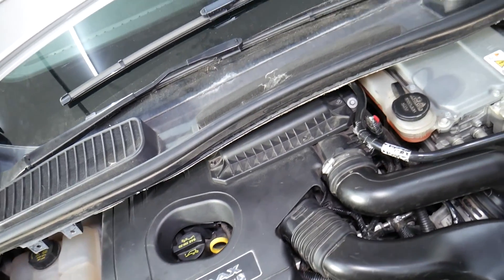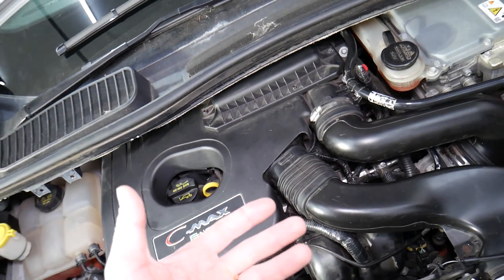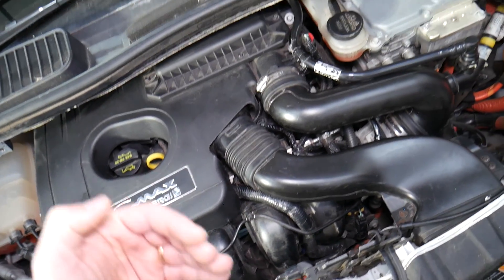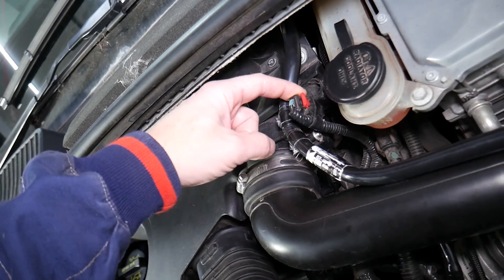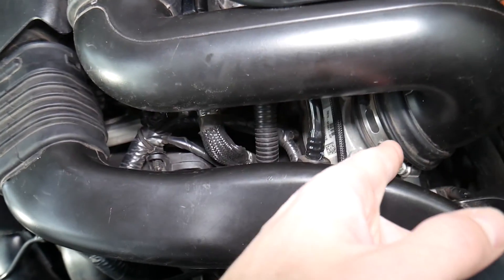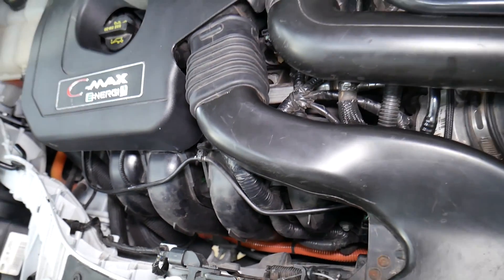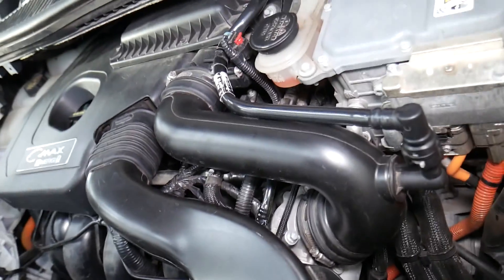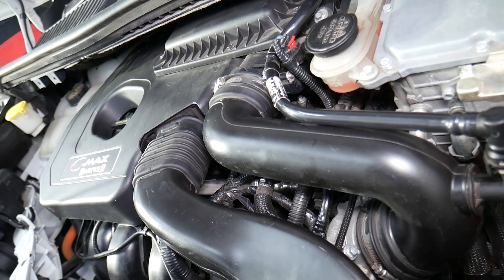The car can also have a misfire due to bad spark plugs or ignition coils. Common causes include a bad fuel injector, weak fuel pump, bad spark plugs, and bad ignition coils. Something most people never think about is a vacuum leak. A vacuum leak is extra air the engine gets without knowing about it. Air enters through the mass airflow sensor, goes through the air filter, and that sensor detects how much air the engine receives. A loose hose clamp, leaking throttle body gasket, leaking intake manifold gasket, or an unhooked vacuum hose will let in extra air, making the mixture lean — more air than needed — which results in rough idle.